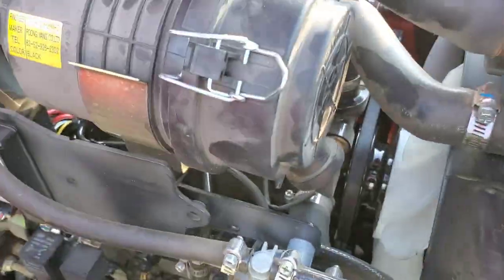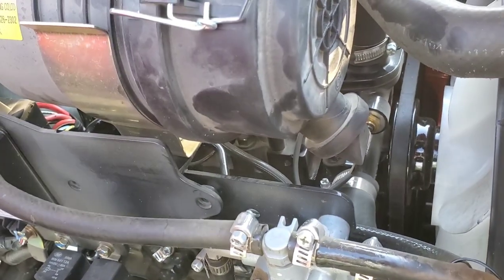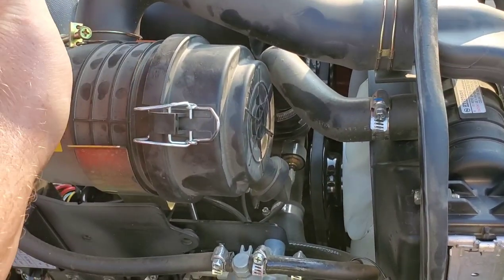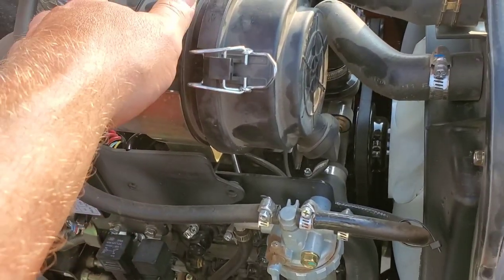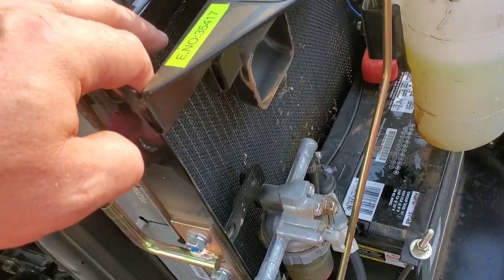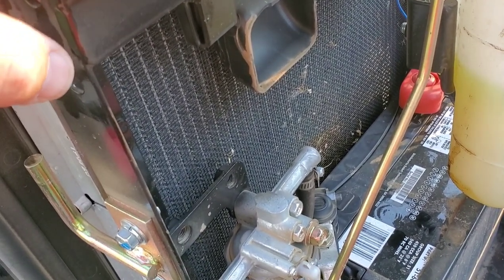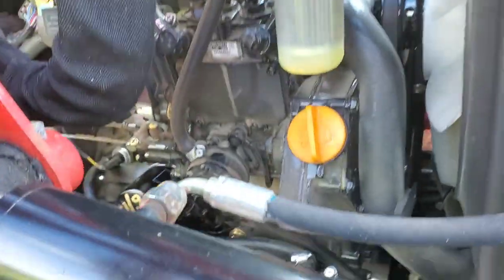Now you've got a really unrestricted way to access everything that you need to. You can undo the air filter here — just two clips, pops it out — blow some compressed air on it, clean it up a little bit. It doesn't say to do that as part of the 50 hour service, but it's a good practice to keep. As well as your front grill screen here — blow off any gunk that's in there. I've got a little bit of grass clippings stuck in there, so you just take a little compressed air and blow that out. Keeps everything breathing like it should.